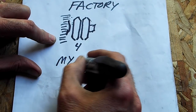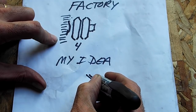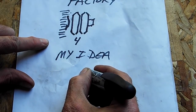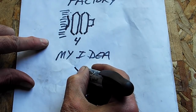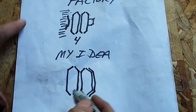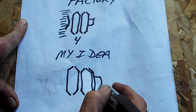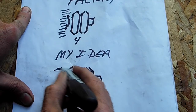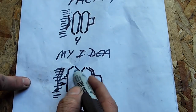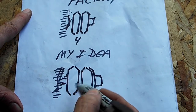So here's my idea, and that is putting two of those Belleville washers at the back together, first of all. Okay, and then putting in the factory original configuration like that. So you've got the factory four plus this fifth one in the back. So there's really two back here pushing outwards. Here's the crankshaft, and it comes through to the chain sprocket. And so that will give it a bit more sturdiness, because these two pushing together against these three are going to make it a bit stronger.